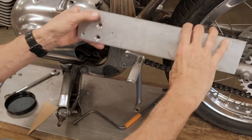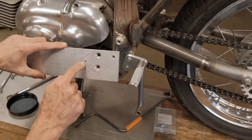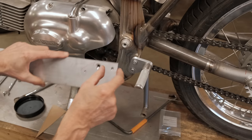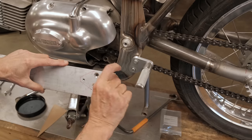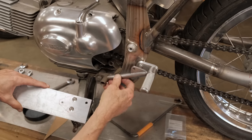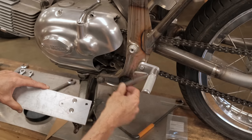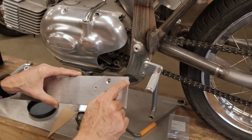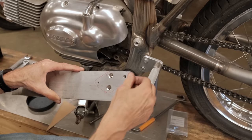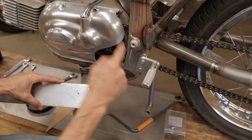Can you see how this goes that way? There's an extension out here and I got a 5mm thread there. So the stop is going to be held onto there, and then I can move the eccentric. So when the brake cable pulls up, this lever only goes up so much, and that's about where it's going to be. So let's go to the hacksaw now and we'll cut this out. I won't sand it up or anything. We'll just have the hacksaw cut. I can file it later and then we can work on the stop.